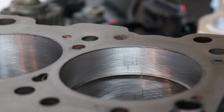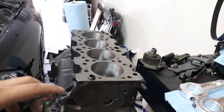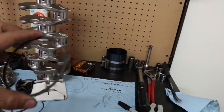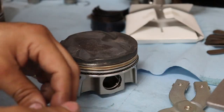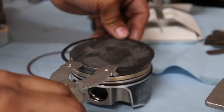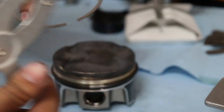After the third time grinding, we're finally at about 24 to 25 thousandths. We'll repeat this for all four cylinders and then do the second ring. The second ring uses the exact same process but we're shooting for about 27 to 28 thousandths, because we know we're going to be running about 45-plus PSI. The oil rings have two small tiny rings — we were shooting for about 18 thousandths and right out of the box they were actually right on spec. Don't try to do it by hand — if you snap a ring you're going to have a bad day.